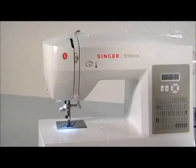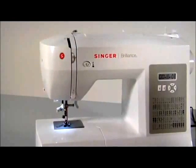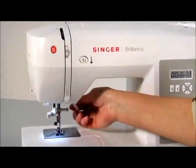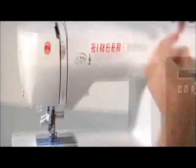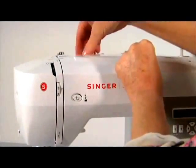Threading. Your machine is very easy to thread. First, tap the foot controller once to raise the needle to its highest position. Raise the presser foot lifter. Place the thread on the spool pin and secure it with the spool pin cap.